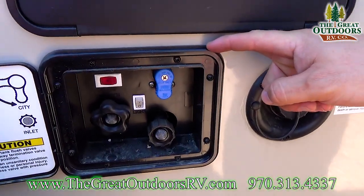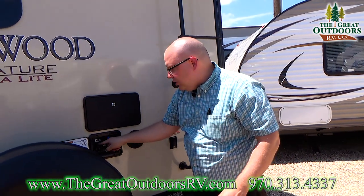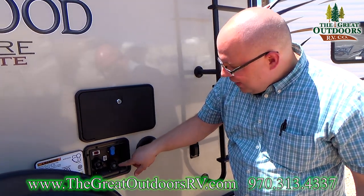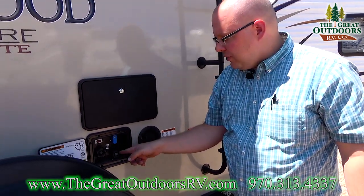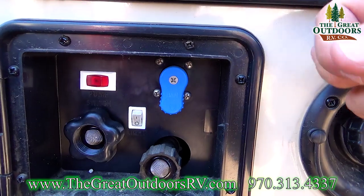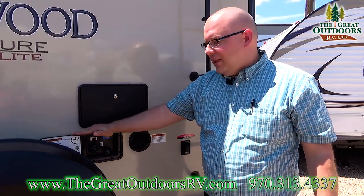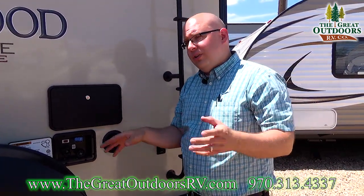Down below is your water connections. There's a diagram here showing you what's going on. This right here is your tank flush — when you go to dump those black tanks, you can hook a hose to this to flush them out and prevent smells from building up inside your coach. And then this is where you would connect your city water line. If you have a connection at a campground for city water, you plug directly into this and leave this little blue knob pointed down. If you're ready to winterize, you simply flip this blue line to point toward the driver's side and plug your hose into a bottle of antifreeze to suck that through your whole system.